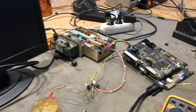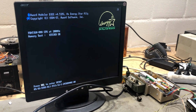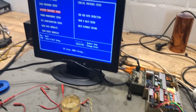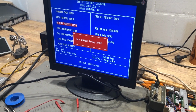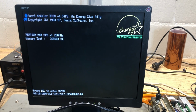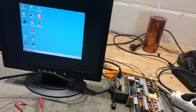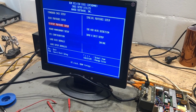Because as soon as we turned on the power supply, we noticed that there wasn't any explosion, which was already good. And we noticed that the screen was absolutely spot on. So there were no issues anymore, no more artifacts, no more discoloring, and everything seemed to work fine. So as I'm moving into the BIOS here, there is absolutely nothing wrong with the screen. Everything is working perfectly. So a big thanks to my friend Gert, who actually fixed this. So the problem all along was probably a bad connection or solder joint on the RAM chips of the video circuit. But luckily all is well again.